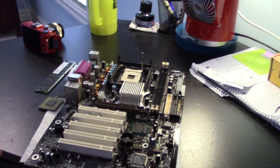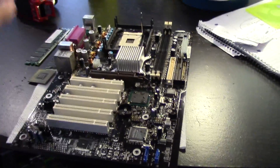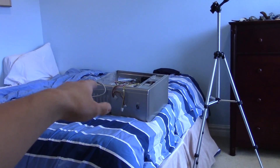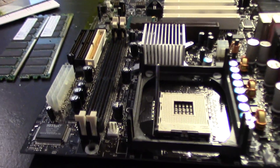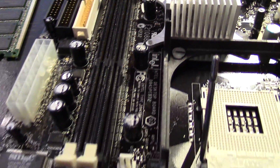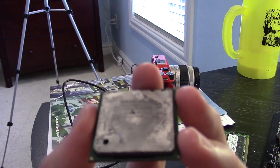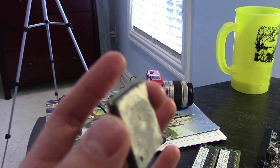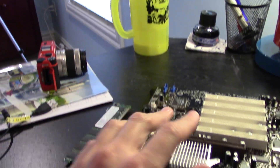I'm going to leave all this here for a couple of hours and let it dry out. I might just leave it out here and hook up the power supply to everything rather than throwing it back in the system, because that would take forever. Either way, we're going to see if the motherboard, RAM, and CPU still function. At this point it's been approximately five hours and I think everything is dry and ready to go. Panning around the motherboard, I don't see any visible water — hopefully everything is good. The CPU looks fine as well, though I was a little disappointed that the wash cycle didn't remove all of the old thermal paste — there's quite a bit of residue still on the top. The RAM looks fine too, so I'm going to throw all of this back together and try to boot the system.